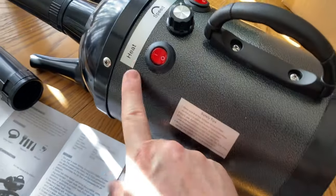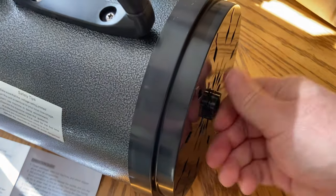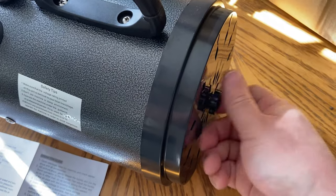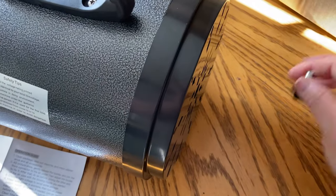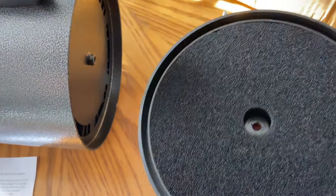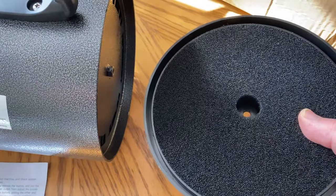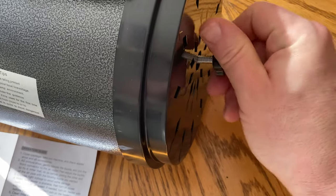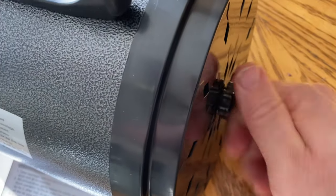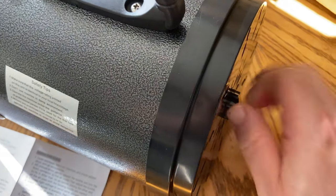Another benefit besides the heat — I love that it has heat because a lot of these don't always have it. When you take the back cover off, inspect everything. Inside you have a screw — don't lose it. There's a filter sponge back there to collect dust and hair, because you don't want anything getting in. Check this regularly — it's washable. Put it back on, screw it in finger-tight. Don't overtighten it or you'll destroy the thread.